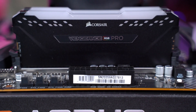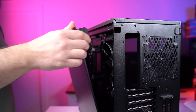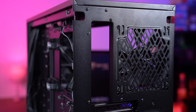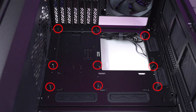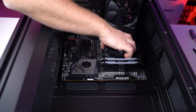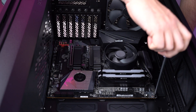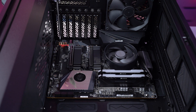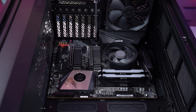Now we want to put the motherboard into the case. Remove both side panels from the case. There's usually a box or bag of screws in it — take this out as we'll need it for the rest of the build. If your motherboard has a separate I/O shield, install it now in the gap at the back. The case I'm using already has standoffs installed; however, if you need to install standoffs you can screw them in aligned with the holes in your motherboard — sometimes they need six, sometimes nine. Gently lower the motherboard into the case and make sure the holes are perfectly aligned with the standoffs. Use the small motherboard screws to hold it in place, one for each standoff. Tighten the screws but don't over-tighten, as this can put stress on your motherboard.